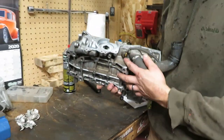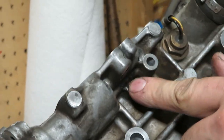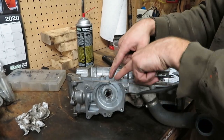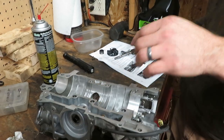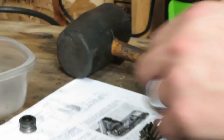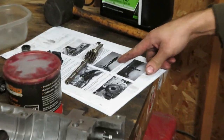If you were having water pump seals leaking, now is when you would replace those. There's a little hole here — a lot of coolant coming out of there tells you your seals are bad. There are two seals inside the water pump shaft that need special presses to remove. We took the shaft out because the impeller was actually broken on the original unit.